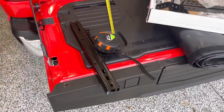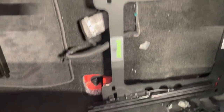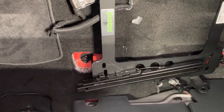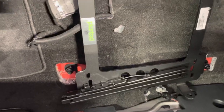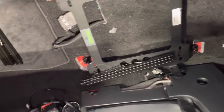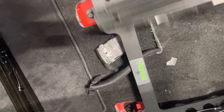Basically what we're doing here, we're taking the universal slider — you can order that in a one-inch slider kit. We're taking the Corbeau seat and then we're using the Planted brackets. Planted makes these. They have not tested them on a 2021 or 2022 F-150, so they went ahead and sent us a set to test fit. We don't have the driver's side, but being as the passenger side mounts up and we pre-measured the holes, the brackets don't look like they've changed. With the Corbeau mounting, these brackets are a universal bracket made for multiple seats, so the measurement from here to here fits the Corbeau from left to right.